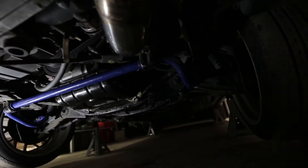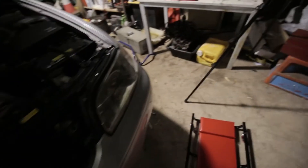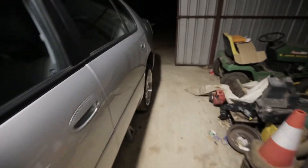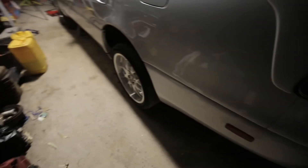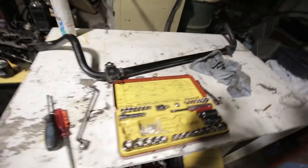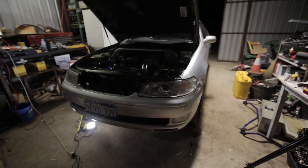Overall, it's going pretty good. Front sway bar is in, and the end links are done up, and it's looking really, really good. Now it's time for the rears, and I think I might have to disconnect the exhaust for that. But if I do that, I'm definitely going to start it up straight through. Depends how much I want to piss off the neighbours. So I just have to do the rears, and then I'm all done. There's the rear sway bar there. Here is the factory front sway bar — it's very, very light. I can lift it with one finger. I cannot do that with the aftermarket sway bar. I'm keen to see how much of a difference this will actually make. Alright, onto the rears.